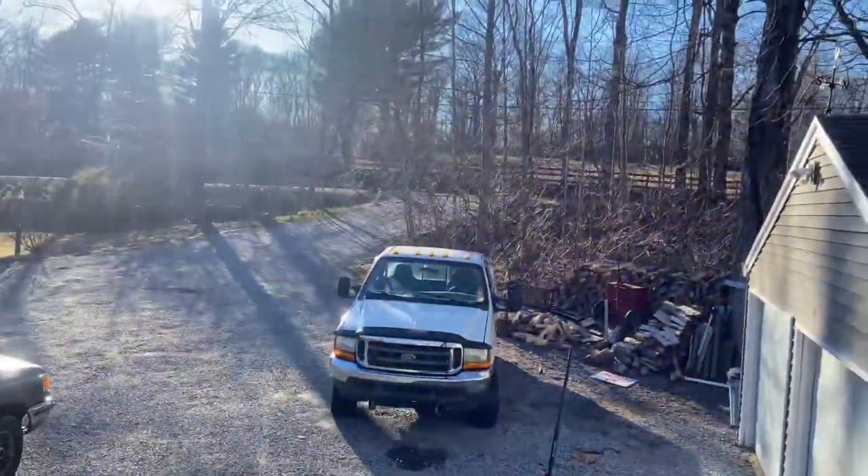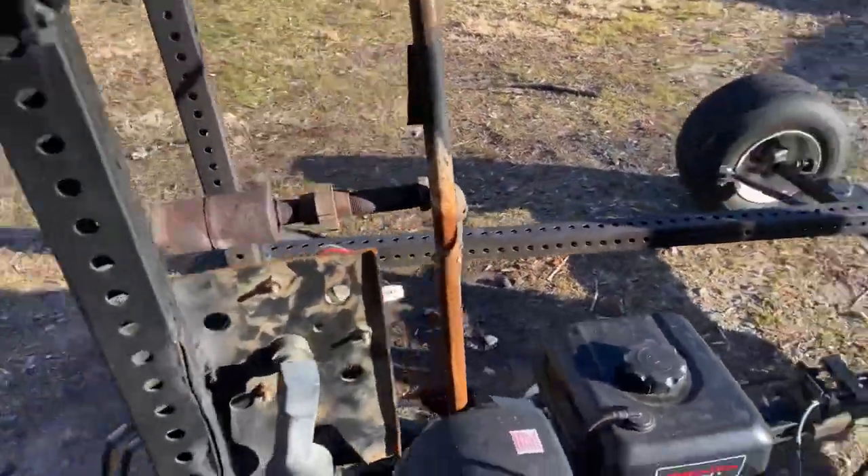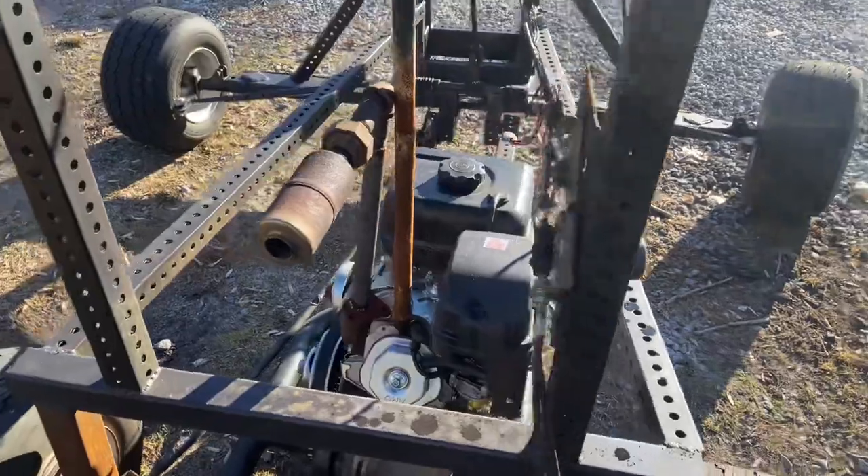Pretty successful drive. We got up the steep driveway pretty good. And yeah, I'm loving the new exhaust I just put on the back. Still got to cut off the hood stack — that thing was a mess. So yeah, that's me driving my world's tallest golf cart. The reason why I took the hood stack off is because a bunch of water kept getting in it, and it would actually hydro-lock the engine. So I was not having too much fun with that.